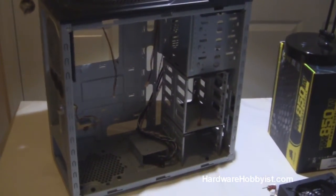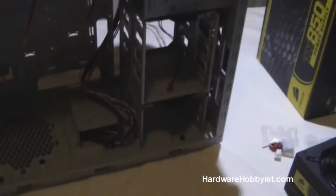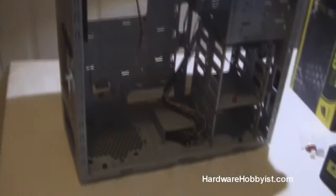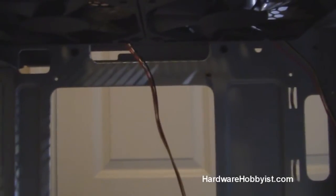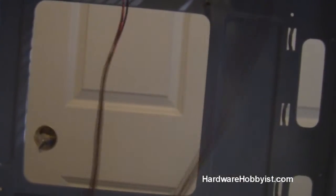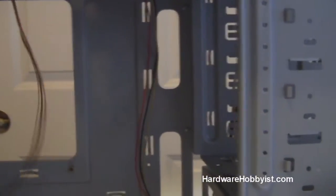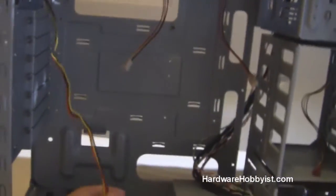Max and I just got done installing four case fans for a grand total of five. Now we're going to move on to installing the power supply. But quickly before we do that, notice how we already have cable management in mind when we install the top fans. For example, we have the connectors facing closest to the motherboard so we can hide those in between here if we wanted to. So always have a goal in mind when you start installing stuff.